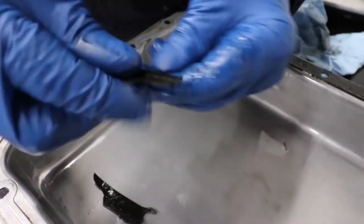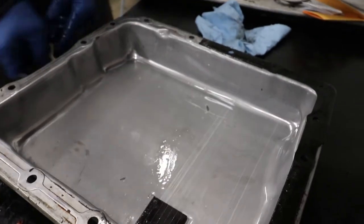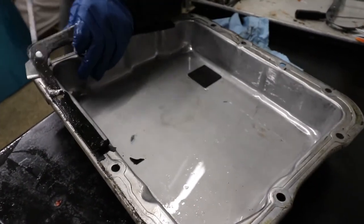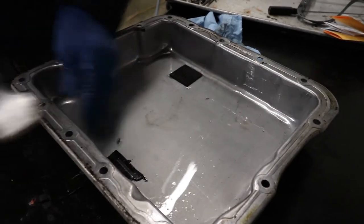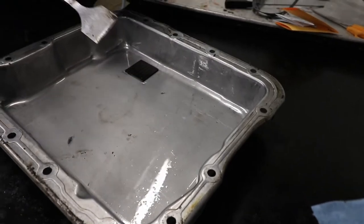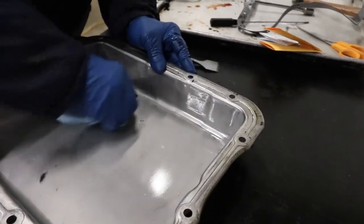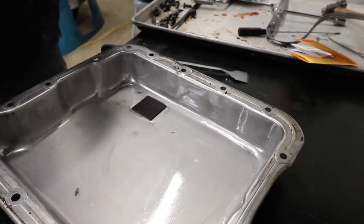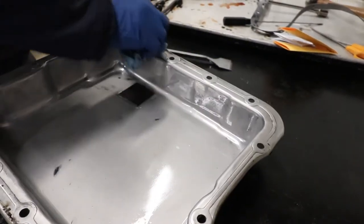You can see how brittle these get. Terry's done this a whole bunch of times — this is his forte. He's using a gasket remover tool, which makes it a lot easier to get most of it out. The magnet you can rub and rub and it'll always have something on it, but you try to get it as clean as you can because metallic debris going up inside the transmission running around in little pieces is what that magnet is there to prevent.